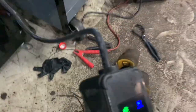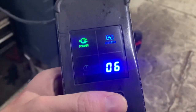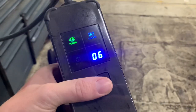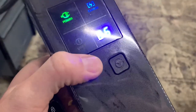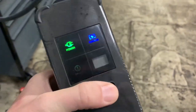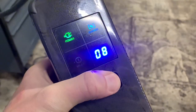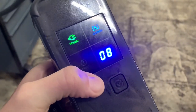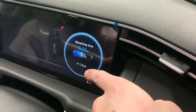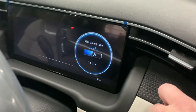Back to the box. On the box it's telling us it's charging at six amps, and six amps is allowing us to put about one kilowatt every hour into the vehicle. So what I do is see the little button along here — hold that, it flashes, press it again — now we're up to eight amps. Hold it down and it sets at eight amps. Looking at the binnacle again, we've now moved up to 1.4 kilowatts every hour going into the car, and now it's telling us it'll take about five and a half hours.